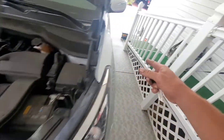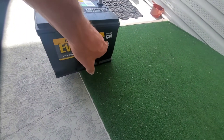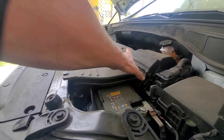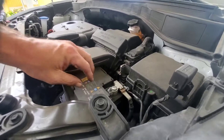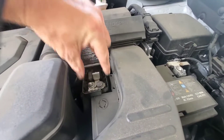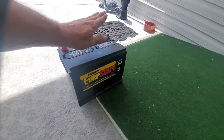Your battery on this one is a 48H if I'm not mistaken. The customer went and got another battery from Walmart, but this is not the correct battery — this is a 124R. That would possibly work, but if you see the difference here, this one has a recessed top, so this terminal will sit down lower. The reason it does that is because this airflow tube runs through here — it catches cold air from the grill and goes through to your air box. So this battery has to sit a little bit lower than normal, and to do that they recess these terminals, both the positive and the negative. The positive connector has to sit down in that little recess as well as the negative. And if you look at this battery here, there's no recess — this is a flush-mounted terminal battery, so this is an incorrect battery.